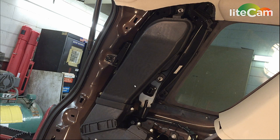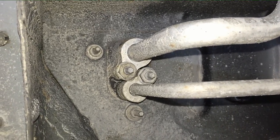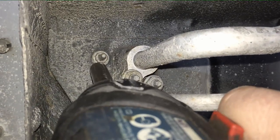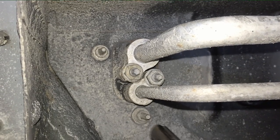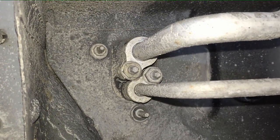There's a section of video missing detailing how to unbolt the box from the body. The way you do that is: there's a 10mm bolt here and a 10mm bolt here, plus a little push pin. Down below, right underneath the HVAC housing, you'll see two 10mm nuts — this one and that one. Do not touch the other nuts nearby — those have pressurized refrigerant lines connected to them. Just remove the two specified nuts.